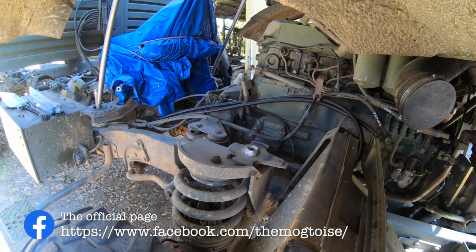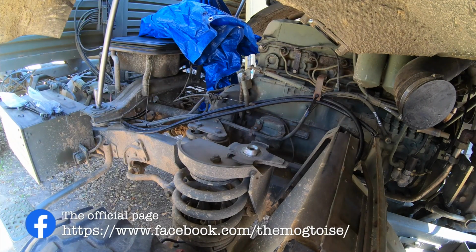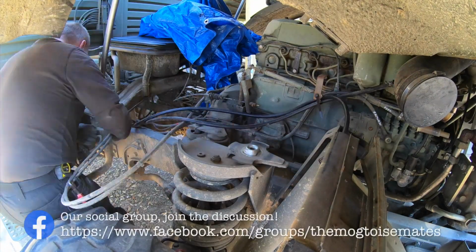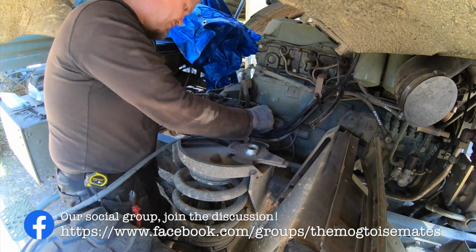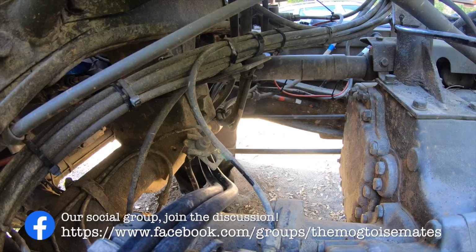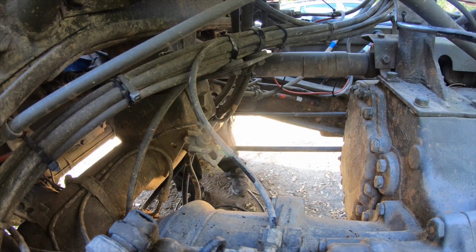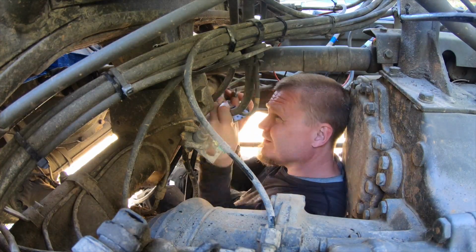My first tip is that in this case I put the 2 ends of the hoses at the engine, one end acting as the feed line and the other one as the return line. I then routed the looped end to the tank. Once all in place, I could cut the hose in 2 places, and thus I was left with a single leftover piece. Another benefit of this was that the end that I was pushing along the dirty frame was sealed and I didn't collect any dirt.